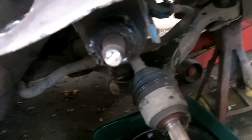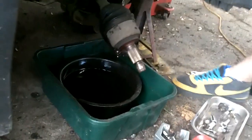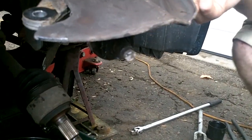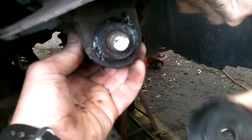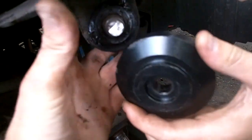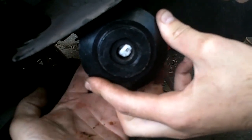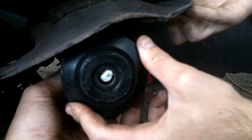We'll get to this and show you. We're using a big ball joint press — you can get these at Princess Auto in Canada or Harbor Freight in the United States for about 29 bucks or less on sale. We're going to press the upper ball joint out. We're using this cup to receive the top of the ball joint where the back of the big C-clamp goes, then this adapter pushes it through the arm. Then we'll just reverse the process to pull the new one back in.